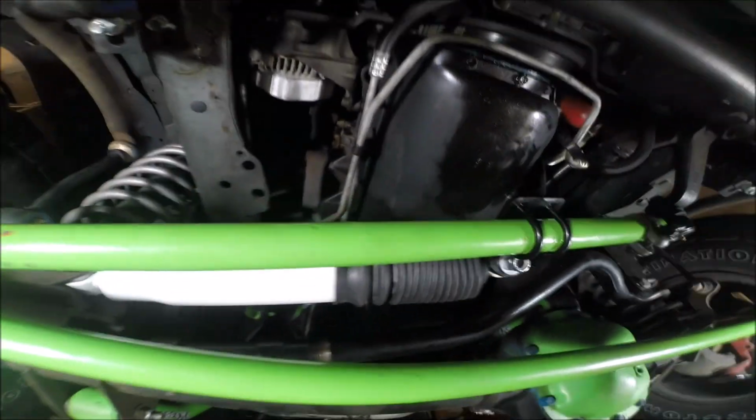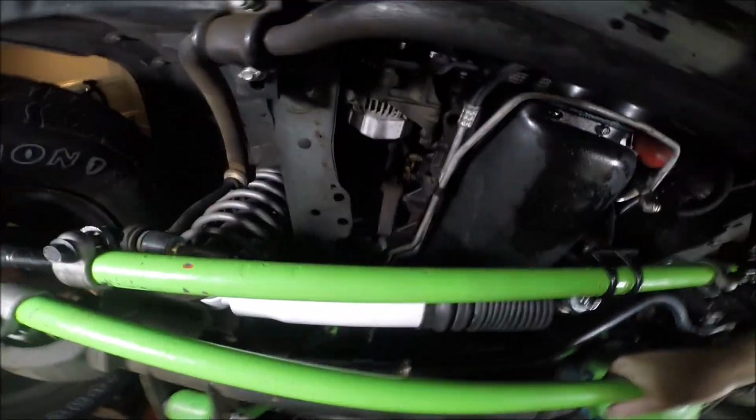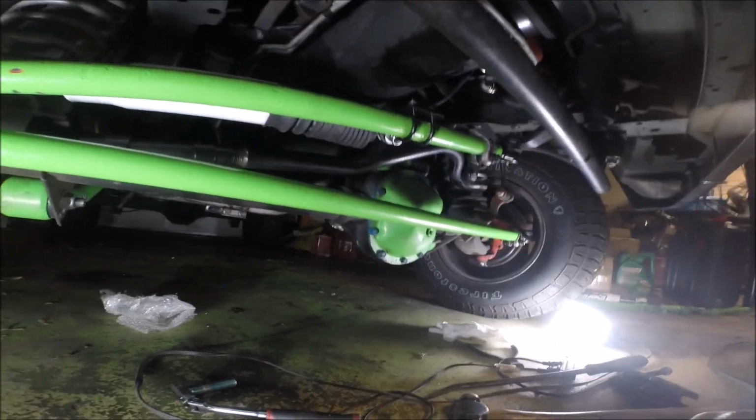So I'm gonna torque, I'm going to grease. I've got four clamps to torque to 35. I've got 1, 2, 3, 4 castle nuts to torque to 60. Then I'm gonna grease, and then I'm taking it for a professional alignment, and your job is done. Look, as far as looks goes, I like it. It's a good looking kit. It looks very similar to a lot of the one-ton steering setups that you can get from other places like I talked about earlier.